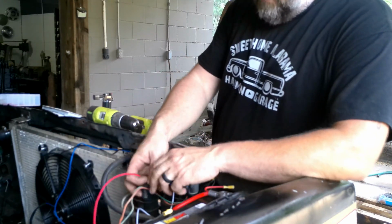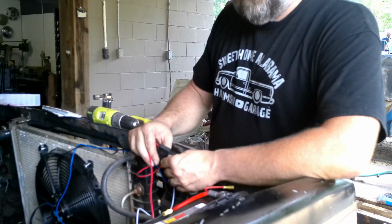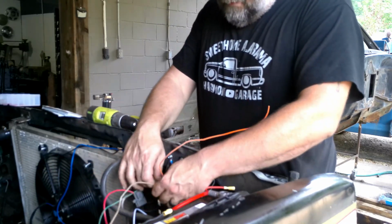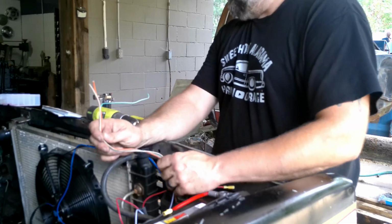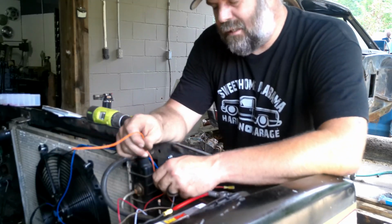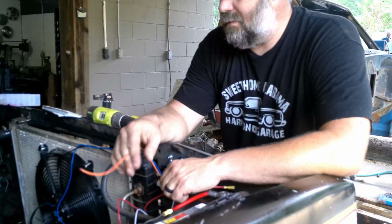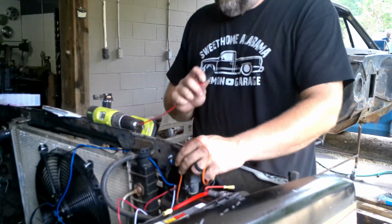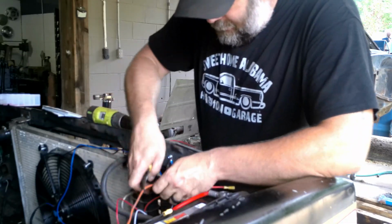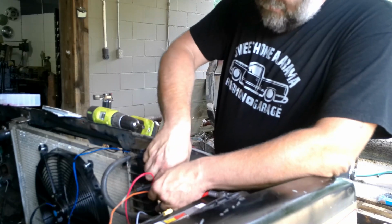Okay, now on the relay for the electric fans, red wire, 12 volt battery, constant power, has an inline fuse in it. Our fuel pump relay, our 12 volt battery constant, is this orange wire. It does not have an inline fuse in it. That's because it went to a computer and the computer was fused and yada, you get the picture. So anyways, I just so happen to have one right here. So we're gonna trim this wire back a little bit. I'm trying to make all this stuff the same length so it looks good, but probably won't. Anyways, and trim our orange wire back.